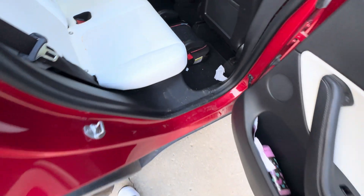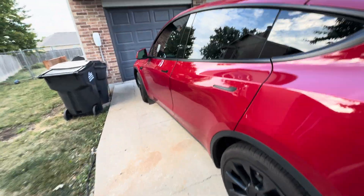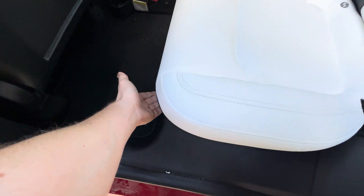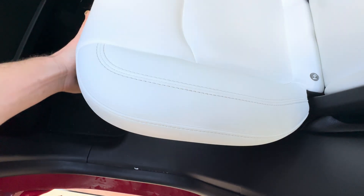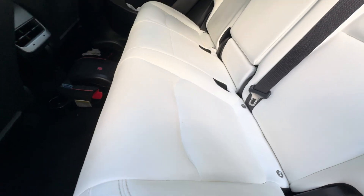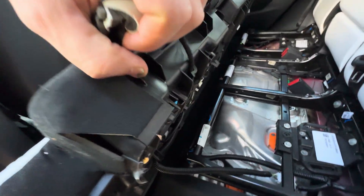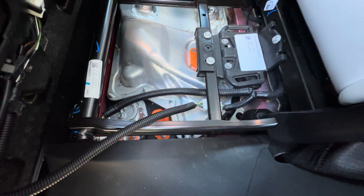So you pop that side up, and then you go over to the other side. We're still charging now and everything's good. You grab the corner right here and you just lift straight up — just like that. You lift up and pull the seat out. I was trying to do this one-handed, I apologize. Now be careful when you pull the seat out — don't pull it out too hard because you have heated seats, so you'll literally rip the wiring harness right out.